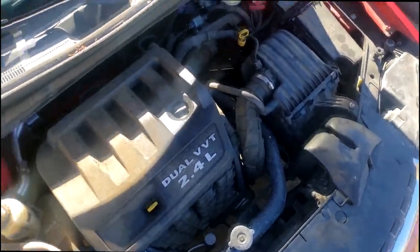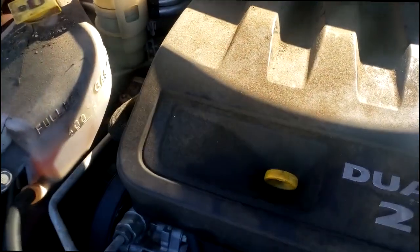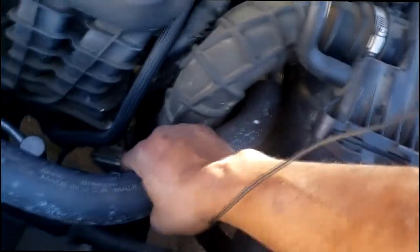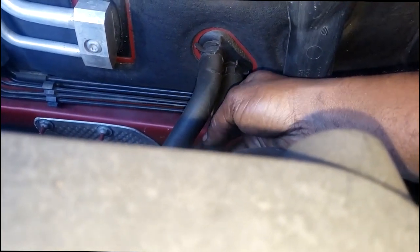Alright, a little 2.4 dual VVT engine. Good thing it's a four cylinder — these heater hoses are easily accessible. I have coolant in my reservoir, and this hose is fairly hot. The thermostat is right here — when it opens, hot coolant comes out and goes back to the radiator. Now let's verify: the inlet is hot, but the outlet is cooler than the intake. There could be some form of restriction. If one hose is cooler than the other, suspect a restriction; if both are hot, suspect distribution problems.